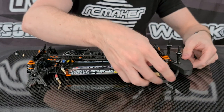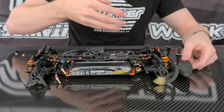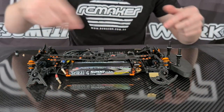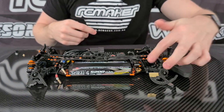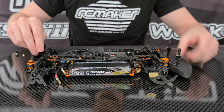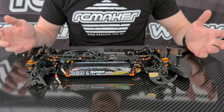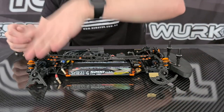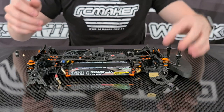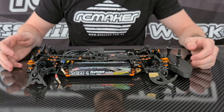You can see how nice this is — it's perfectly free, they spin really easily with no resistance at all, and this is going to tell you every time if your tweak's out or not. To do the other end, you're going to flip this to the back — it doesn't matter which way the wheel's facing as long as you can see it's spinning, that's exactly how you want it. Just repeat this process, flip them around, move this to the back and this to the front, and you can then start working on your front collars as well. That way you'll get your tweak perfect every single time.